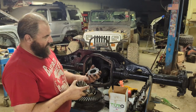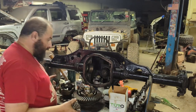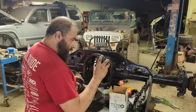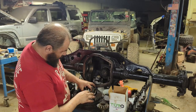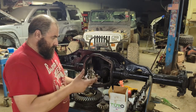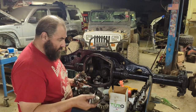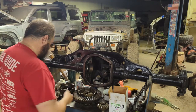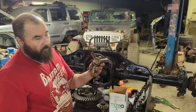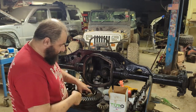Similar to a transmission or any other limited-slip differential, for that matter. We'll throw these away — I don't think we need any of these. We'll set the side gear aside, then pull out our three-pinion center piece. We'll pull the spider gears off — we're definitely not going to use those. This center piece we are going to reuse, so hang on to that one. Then the second clutch pack down inside is the same as the first.